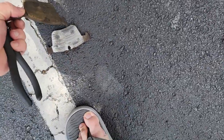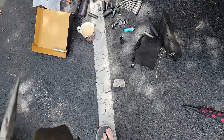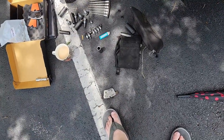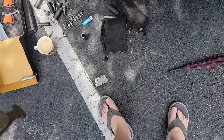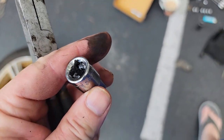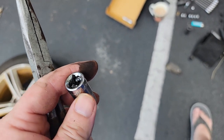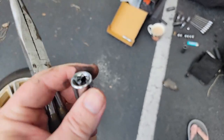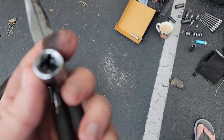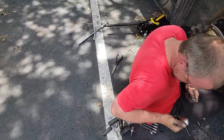I mean, that's not good. This is the counterpart — plenty of material left. So either the pad material came off or the sliders aren't moving. The sliders are moving. And it is the one where you've got to actually rewind the piston. O'Reilly's, Advanced, AutoZone — I understand you guys want to protect yourselves and keep people from stealing stuff off the shelves, but this is ridiculous.